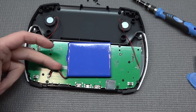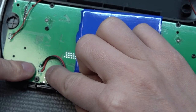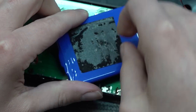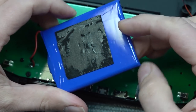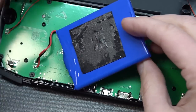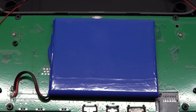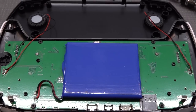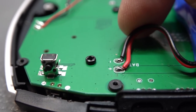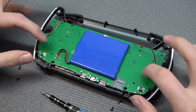The battery has been soldered in completely without a plug, and the contacts are very close together. So if you need to remove it, you need to do some soldering. Unfortunately there's no clear label to identify exactly what battery it is. Looking at the shell I think there is still room for a bigger battery, so that would be an upgrade you can do. The overall soldering has been done quite nicely. The next part involves removing the last four screws and lifting up the other part.